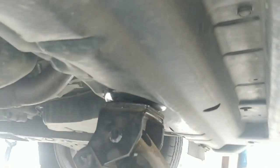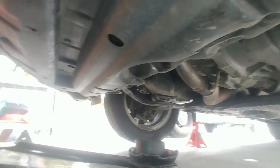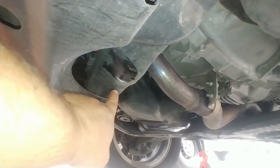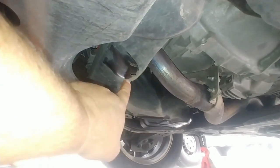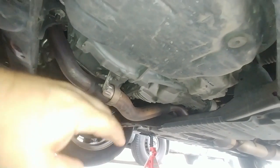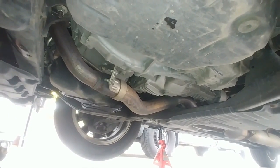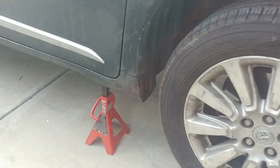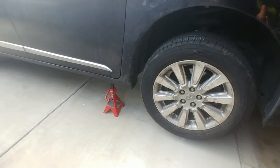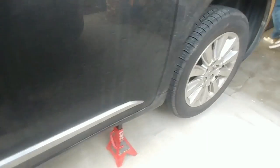To get the vehicle lifted, there's a little indentation right here — if you lift it by the center you'll get a much better even lift. You can also go right underneath the subframe right here and lift up. Do not lift from right here as you'll bend it. Do not try lifting from the oil pan or the transmission pan as those will crack. Put the vehicle on jack stands — I call them horses — make sure you've got your rear parking brake set, and then go ahead and start removing the wheels.